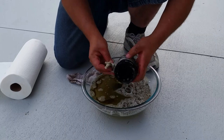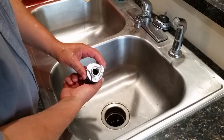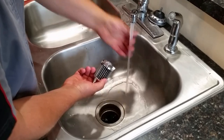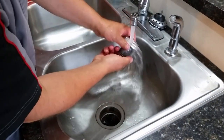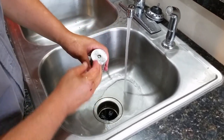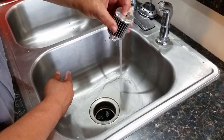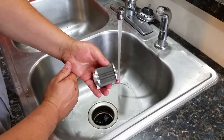Now that the filter is all cleaned up with no real residual oil left, I want to go ahead and reverse flush it with some hot water straight out of the tap to flow out anything that might be left. This is where the rare earth magnet is located, and there's an overpressure spring port right there — so if there's too much pressure and the screen gets clogged, it'll flow directly through that little ball valve and flow back up and in. We'll go ahead and put this back together and I'll show you filling the oil.